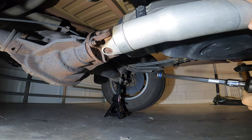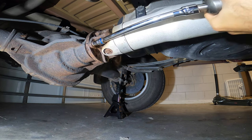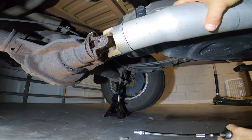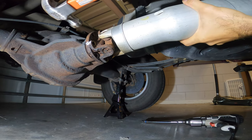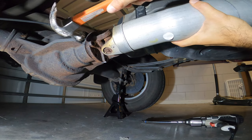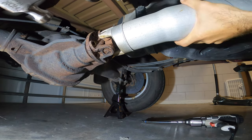I don't think my drive shaft is going to fall off, but I'm just going to support it with my leg. We'll probably have to tap it with a hammer to get it to come off. As I suspected it's not going to come out easily, so let me get a hammer. You want to hold the drive shaft so it doesn't fall when you tap it. You don't want to tap the aluminum part — tap where the flange connects to the u-joint, and go around and give it a few taps.